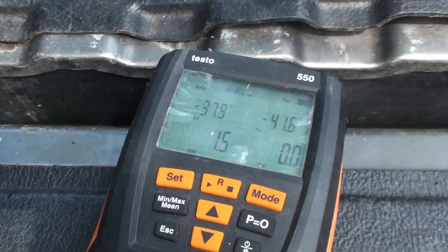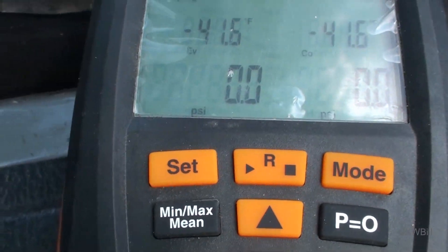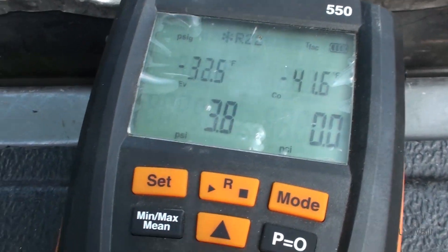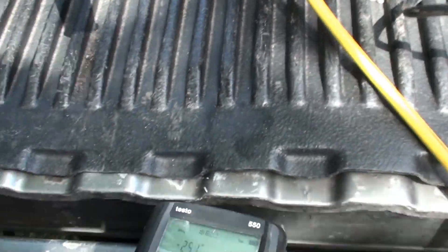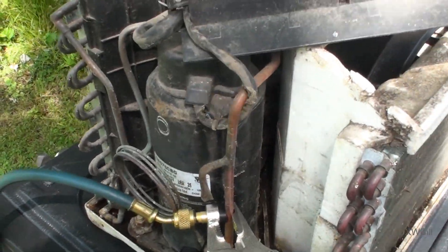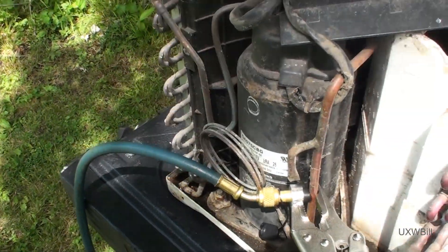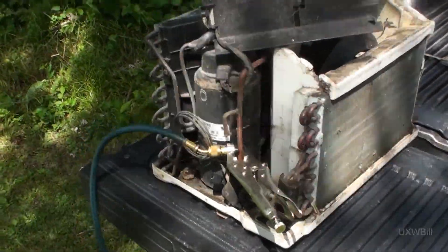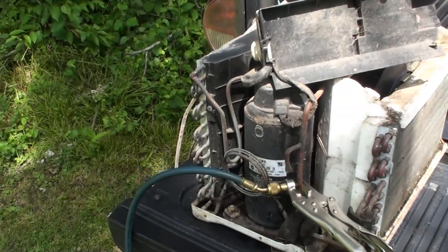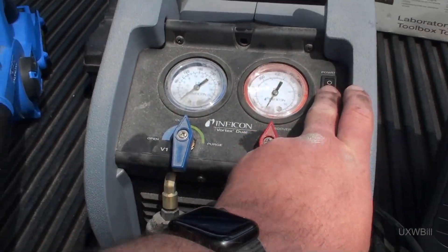We're getting very close. There we are — we just hit zero PSI. So we close that valve, and yeah, you'll see it start to creep up gradually. We'll turn that off and let it rest for a couple of moments, then we'll go again. We're not going to get everything perfectly, but we'll have certainly gotten the majority of it. Then this air conditioner can be safely scrapped without risking any damage to the environment or trouble for myself on the legal front. You can see it's gradually creeping up again — turn the machine back on.